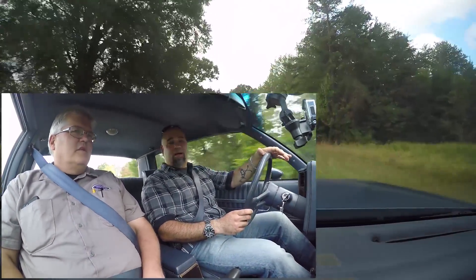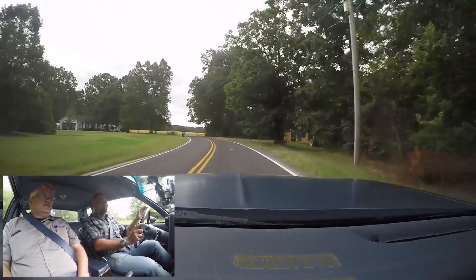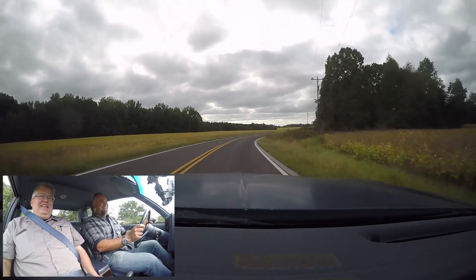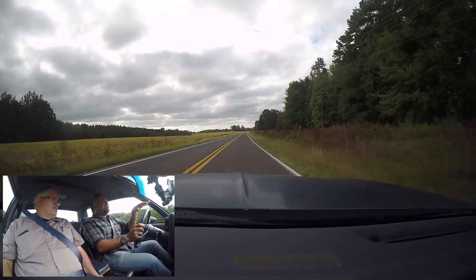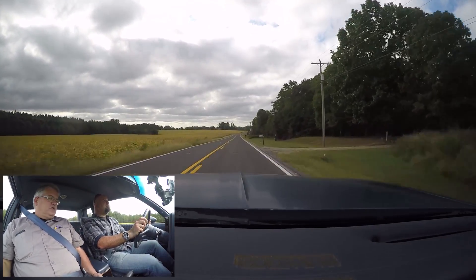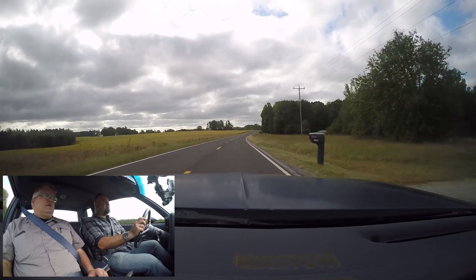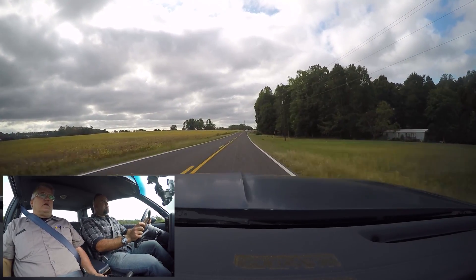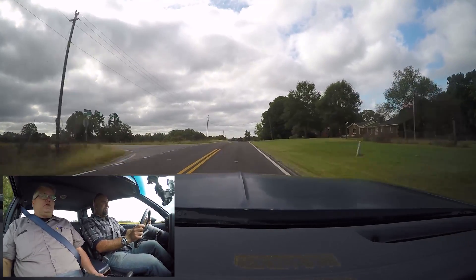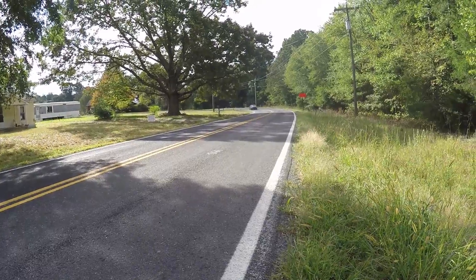It's 81,000 original miles on this car and it's actually really, really clean — a couple nicks and scratches on the outside, but overall a very clean car. It drives really, really good — it's got actual handling. So what does your suspension kit do for this car? It corrects the steering geometry, corrects the front and rear suspension geometry. It has a swivel-length center rear quadrilink rear setup, with our lower and upper control arms and the DSC tuned shock package for the front. You can lay this thing off into a corner. It won't have enough horsepower to get you out of trouble, but it will roll into a corner — it handles so well it'll just roll around things and surprise the heck out of you with how much grip the car has.